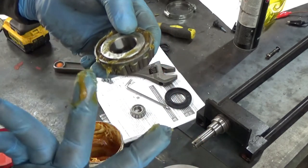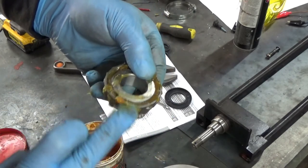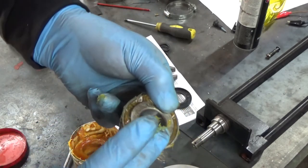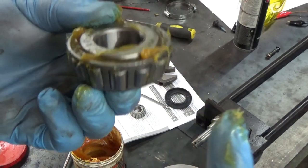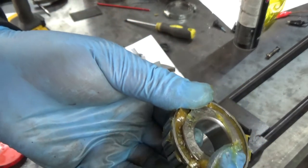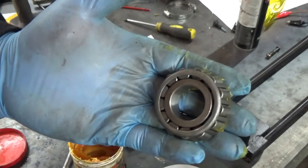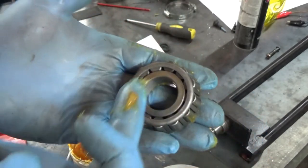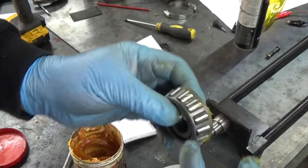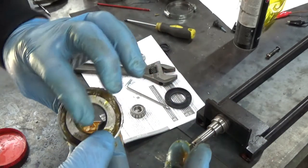You'll see the steel bits left on your fingers — wipe what you've got left on your finger on top. Then use your finger and force it towards the grease bulge. There's a small bulge; force it towards the bulge and try to force in at the same time. What happens is it slowly comes out the other side of the bearing. I'm going to carry on doing that until I've seen it come through — it will actually burst out of the side of the bearings shortly.